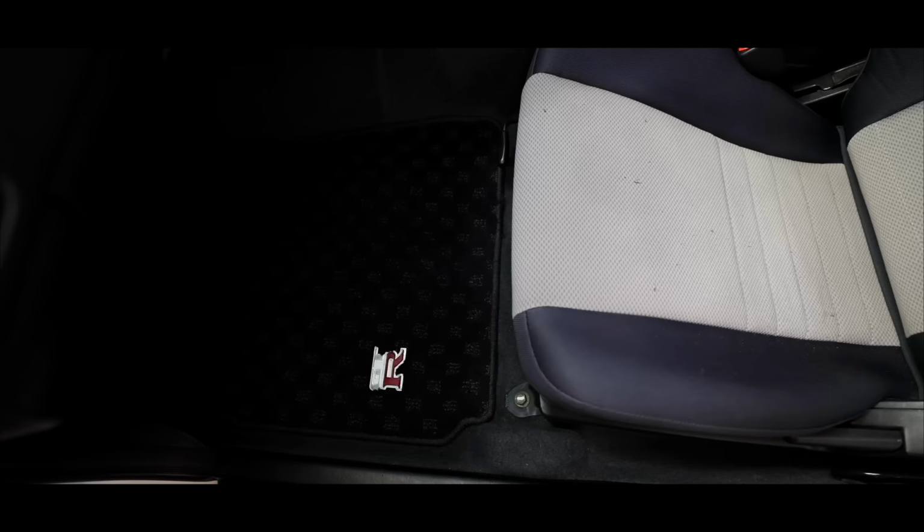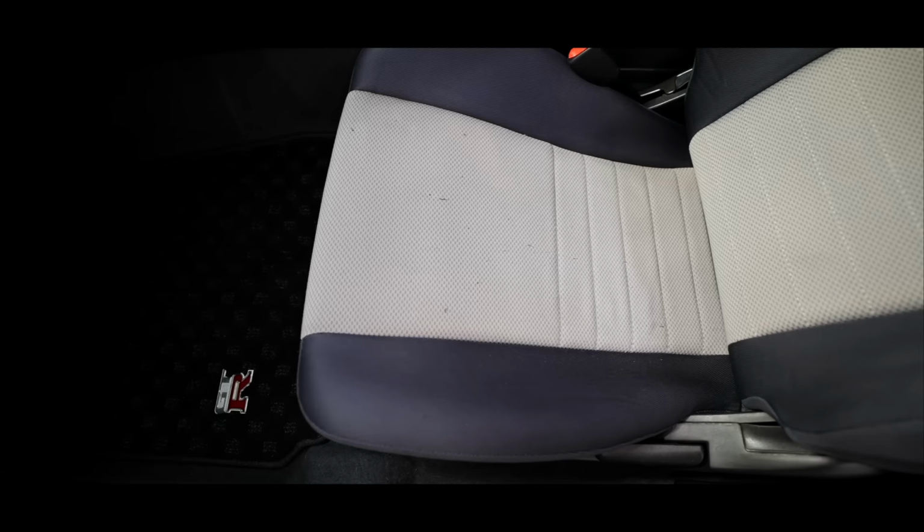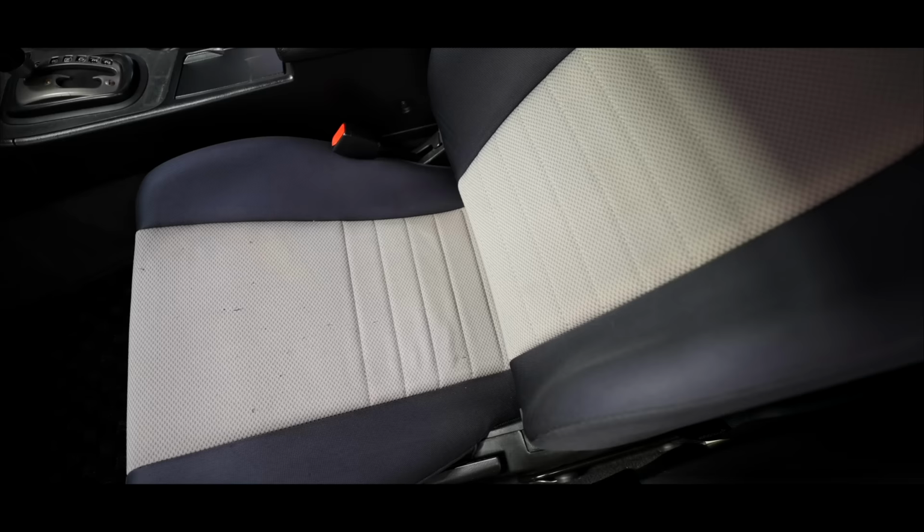Those stains ended up being oil, potentially from a bottle of clean engine oil spilling into that seat, where it's probably been sitting there for years. I actually checked and there was also some oil residue on the carpet directly under the seat. Now, as I mentioned earlier, I've been here before and you can clean and extract that oil till the cows come home, but it won't go away in the moment. Just make sure you degrease the surface well, as I did, and allow it to fully dry, and it shouldn't resurface even when pushing down or sitting back on the seat. So if you're faced with a similar issue, I hope this helps some of you out.